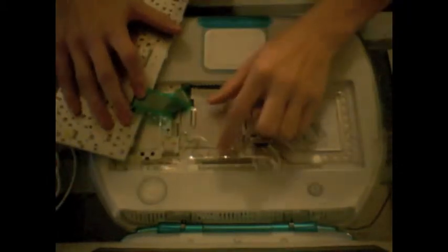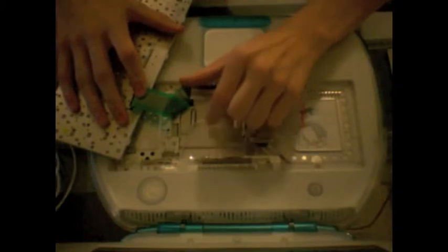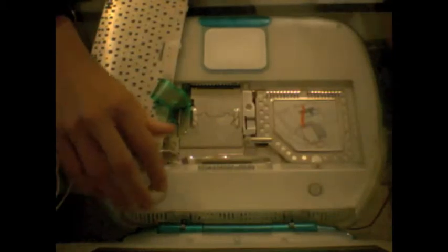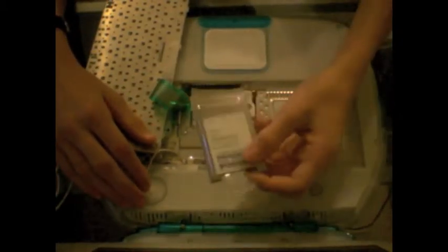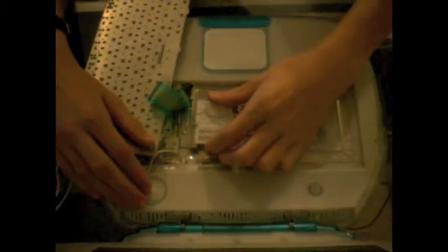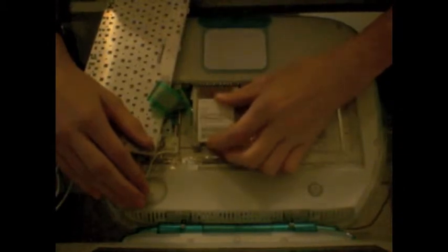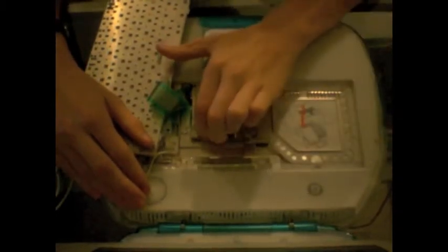This is as far as you need to go. Now you're going to see a little hook here — pull it back. You're going to think you're going to break it, but trust me, you're not. Then pull it up. Untwist your antenna and set that aside for now. It's time for the Airport card. Put that in upside down, underneath these rails. It does take a lot of maneuvering to get it in — not a very good fit, honestly. It's kind of difficult to get in, but you can feel it pop in.